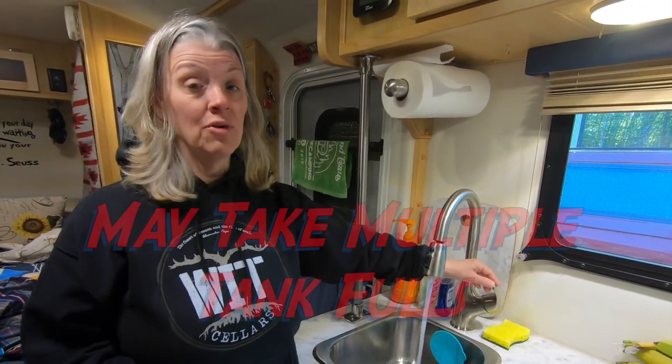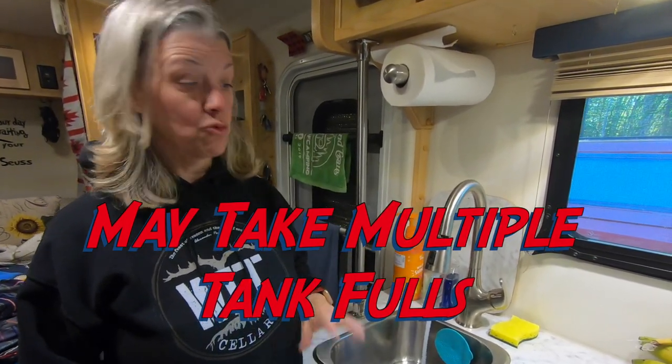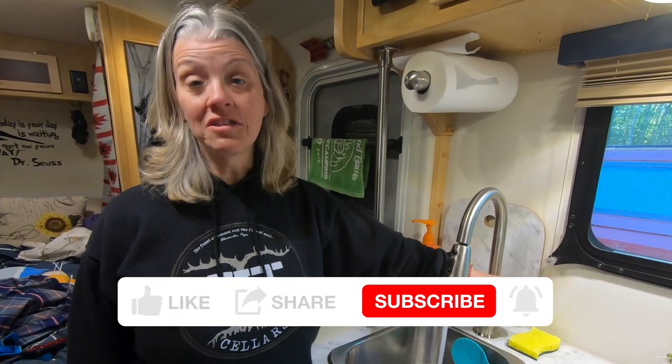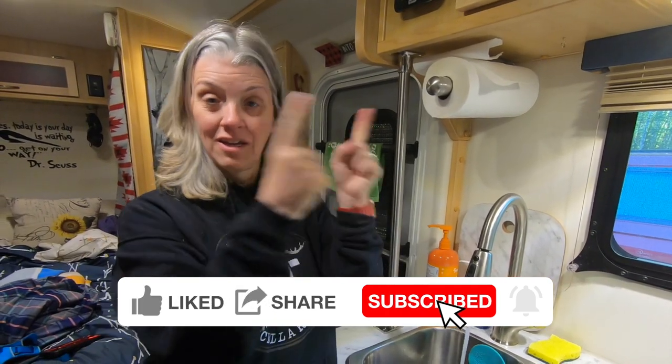One of the last things you want to do is turn your faucets back on — both hot and cold — and run them until you don't smell any more bleach. I'm going to run a whole other tank full through the system, then fill it up with fresh water one more time. The very last step is to make sure you put your hot water heater back in regular mode — take it off bypass so water will run back through your hot water tank and you can have hot water again. If you got any value out of this video please consider subscribing, hit the notification bell, give us a thumbs up, and we'll see you in the next video.